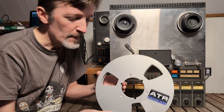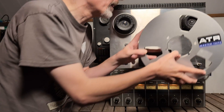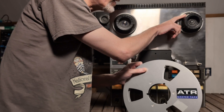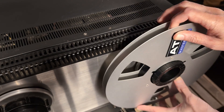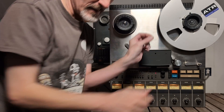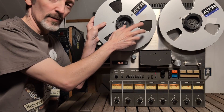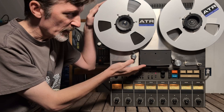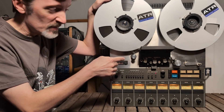I'm using a fairly new reel of tape, so I'm going to put my empty reel on the take-up side. These two little tabs on this reel need to line up so that you can fit the reel over those, and once it's on there, you twist this reel to lock it in place. We have a nice reel of ATR master tape — load that onto the supply side. I'm going to go ahead and lift this little head cover so we can see how the tape is being threaded.